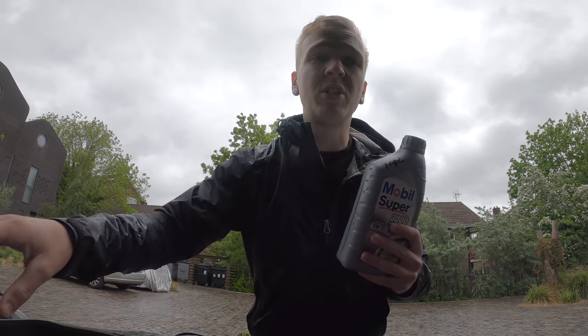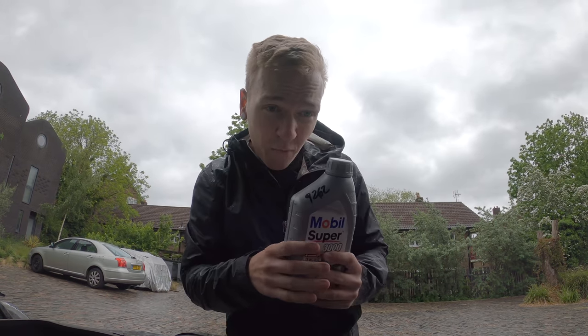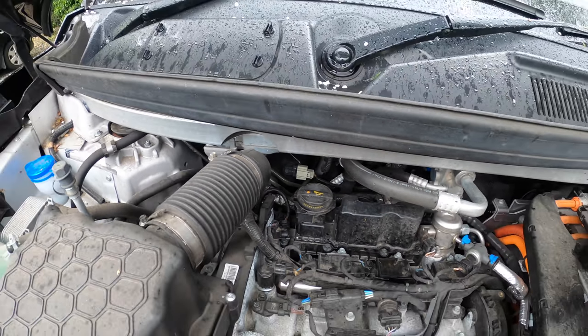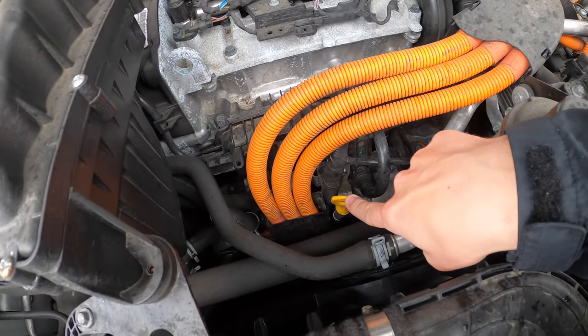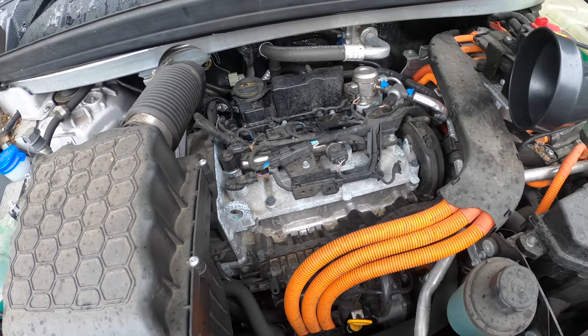So we're going to get in here. I've got myself a flexi funnel because the oil fill-up point is over here and it's a bit of a way to get to. The dipstick's just down here — I've checked this a couple of times and it's just above the minimum mark. Now technically between the minimum and the maximum mark is about one litre, but I'm going to be slow and cautious because having too much oil in an engine is just as bad as having not enough oil. So we're going to top up now.